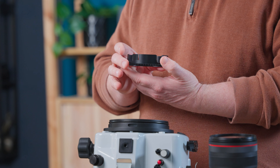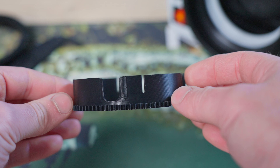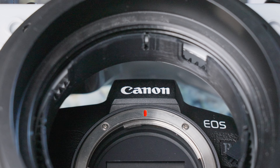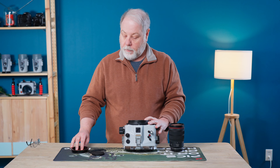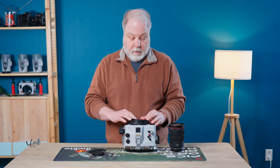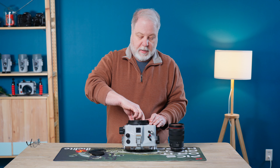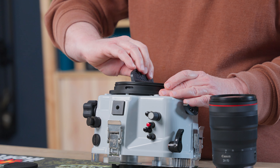You'll note that this gear has got some slots cut in it. There's a very thin slot and then a larger U-shaped slot. The thin slot needs to line up with the red dot on the camera at the 12 o'clock position. Once the zoom gear is in the housing, we're going to install the zoom gear retainer, drop it in, screw it clockwise, and then snug it up with our handy tool.